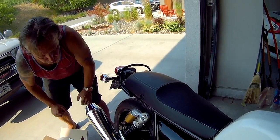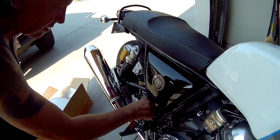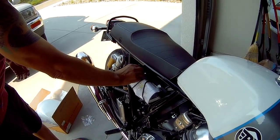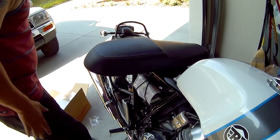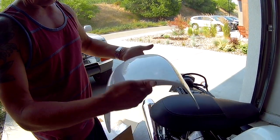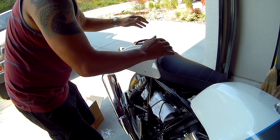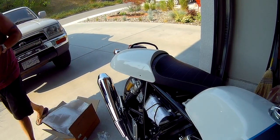The first step on this one is to take off the side cover. Side cover off. Pull the seat release button cable and pop off the seat. The seat cowl itself has a lip at the back, so that has to go in like so, and over top of the seat. It takes a 3mm Allen wrench.